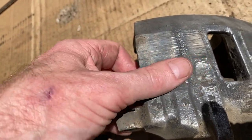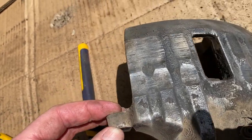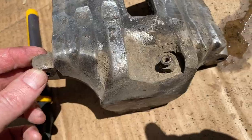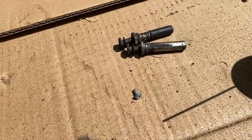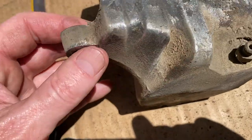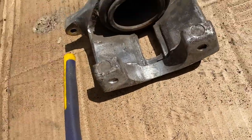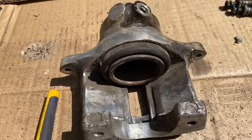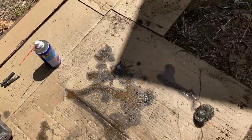I've just taken the top off. Really weird. So there's a bit more work to do on that part just to get it nice and tidy and clean. And there's some caliper bolts over there, so I'm going to rebuild these calipers completely. I think they're just really perished, and the boots are pretty stuffed. Either that, or I buy a whole new set of reconditioned calipers, but they're going to cost like $700 or $800 for a pair. So I'm going to try and do it myself with a kit. Hopefully I'll save a bit of money.